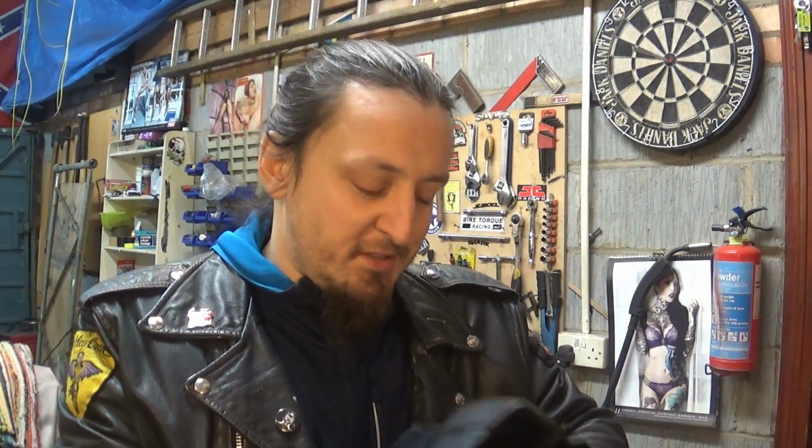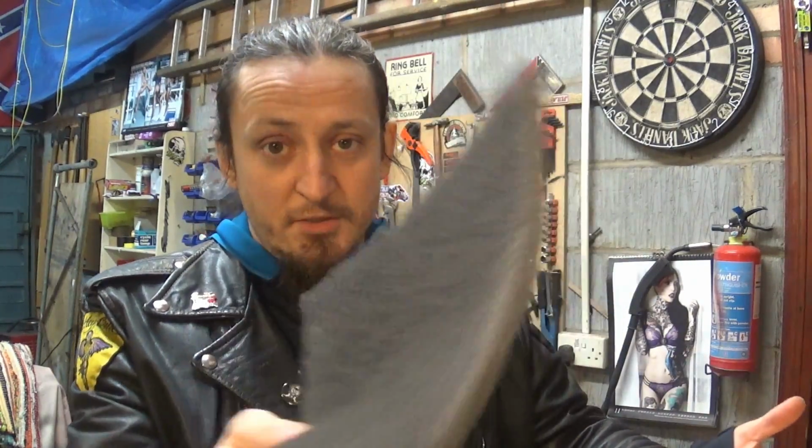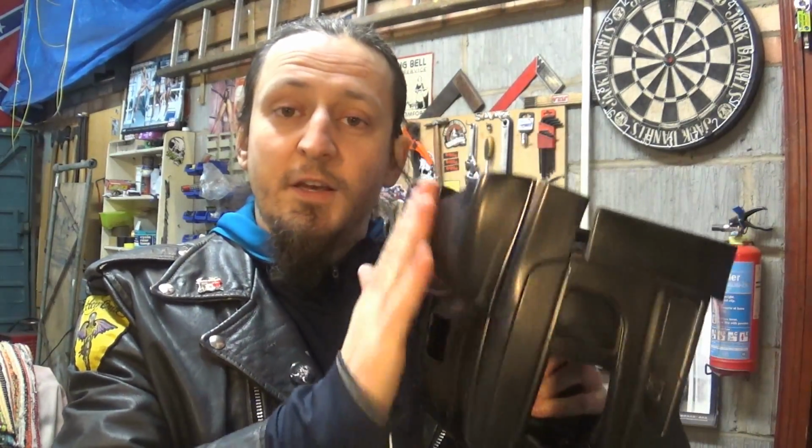But anyway, cut long story short, that's already prepared for paint. I didn't film all that because that was an insanely boring process and very time consuming. All those parts been sanded down because they've been different colors, like red and blue and some other silver colors. So I used my scotch pads for plastic. As you know, I like using scotch pads for plastic because sandpaper is a bit too aggressive in my eyes. So I buffed everything with scotch pads, and then I used a plastic primer.